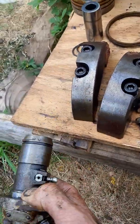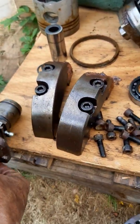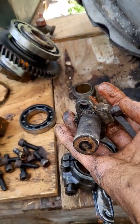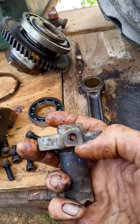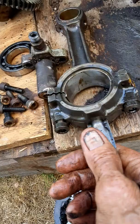The injection pump is stuck, but I've freed up countless injection pumps so I'm pretty certain I'll get that one freed up too. The injector will probably need a new nozzle and some cleaning. As I mentioned in the first video, I'm also missing the banjo bolt for the fuel leak-off — I'll get that sorted.